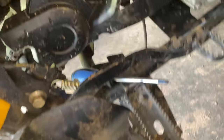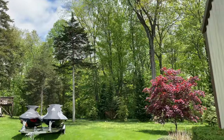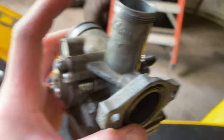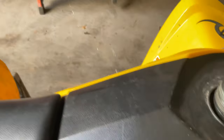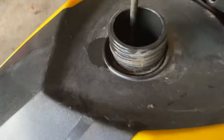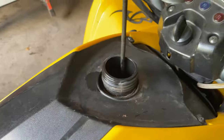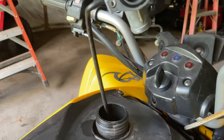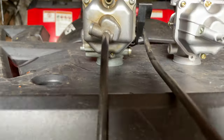I should probably take off the fuel line first — oops. Look at how green everything is, this literally happened over the last day and a half. Old carburetor's out. For some reason fuel was coming out the vent line but nothing was actually coming out of the line where the fuel line connects. Alright, old carburetor's out — I guess we can compare them now.